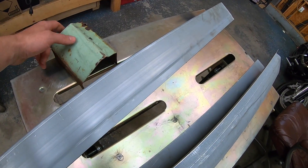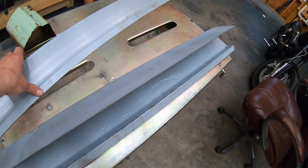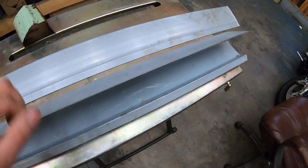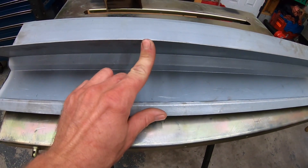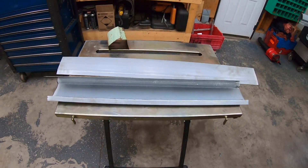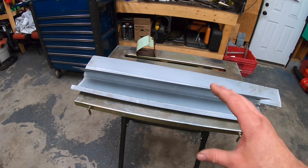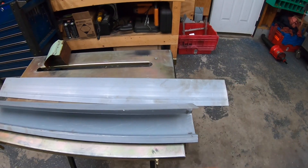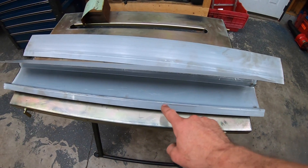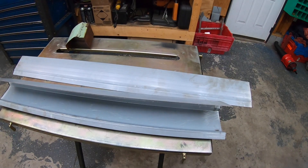The problem came in here. The inner and outer rocker needed to be welded together, and the problem is when I do that it spreads this apart - you can see it's still a little bit flexible - and it changes the curve of the rocker panel. I'm not sure why they sell these in two separate pieces, because it would have been easier to put it in as one piece - just trim it and fit it. So what I did is I drilled holes along this edge and along this edge, and I spot welded the inner and outer together before I put it in the car.